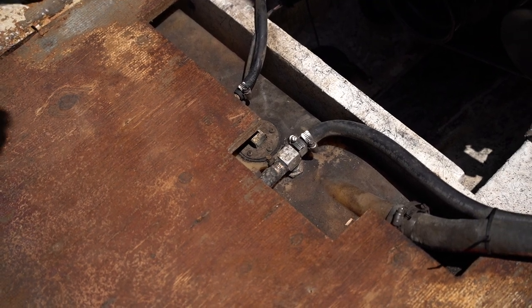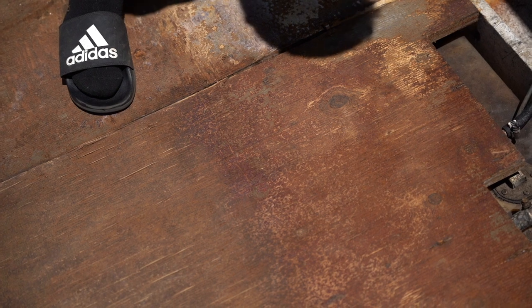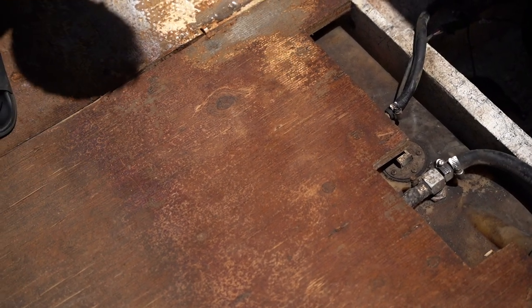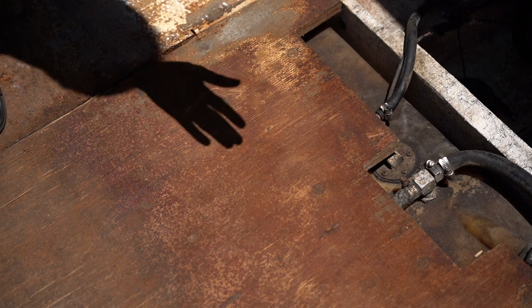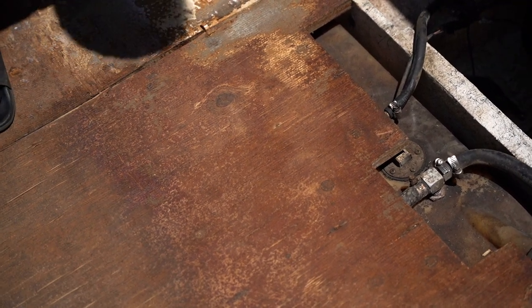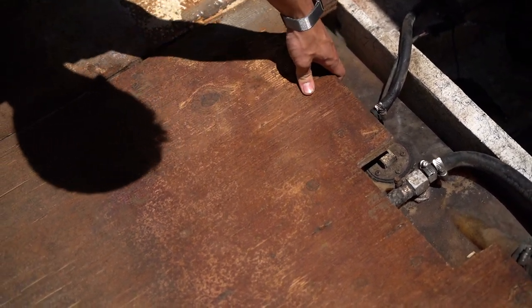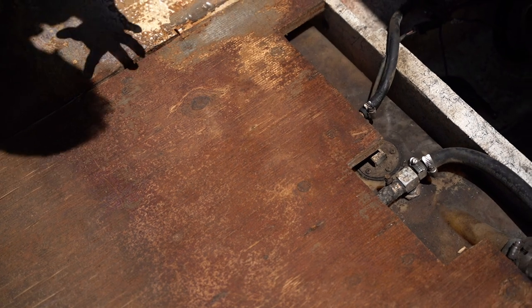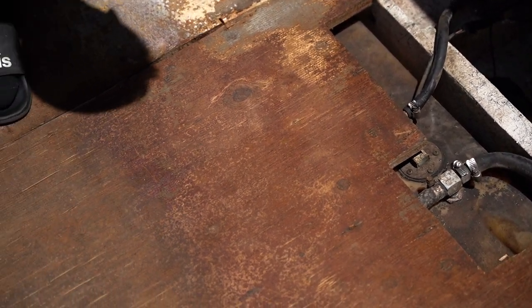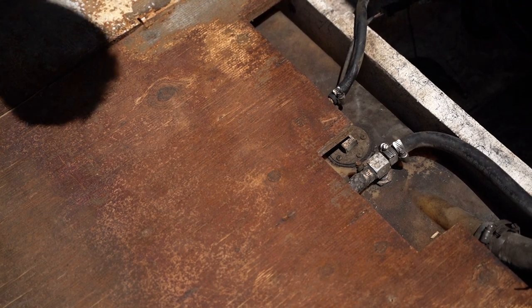And it's warped a lot from the sides. And the thing with marine grade plywood, the only thing that's waterproof, and the reason why they call it marine grade plywood, is because of the adhesive they use to link all the layers of wood together. Because this is still wood at the end of the day, so it's still gonna warp, still gonna deteriorate slowly, especially sitting over a fuel cell with all those potential fumes going up out of the tank and being so close to the engine as well, and so much pressure being walked on.